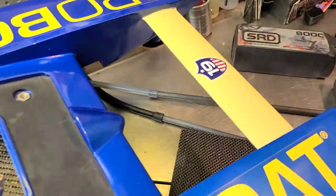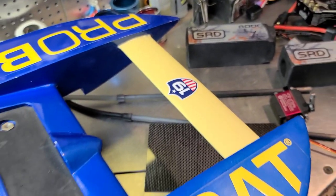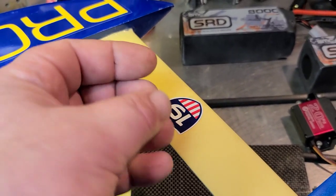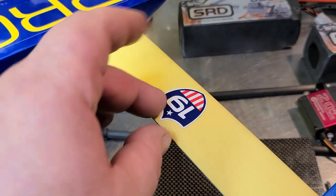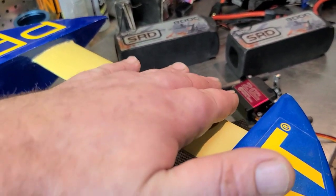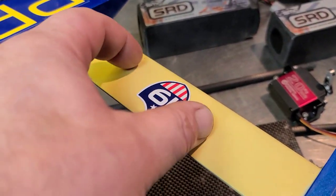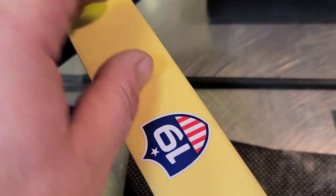Yeah, so I've got some crazing and cracking right here too, where this winglet is. The winglet, by the way, is hollow. Mine is not. I filled it with epoxy, a really thin application of epoxy with fiberglass hairs mixed in it, and I filled this whole winglet. I was sanding some down angle on the front right here, and when I was sanding that down angle, I sanded through the winglet, like right here. But I fixed it, filled it with epoxy, and painted it and everything.